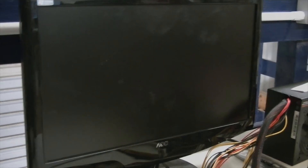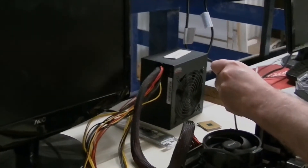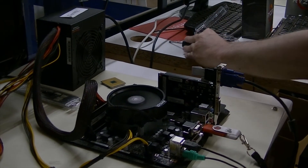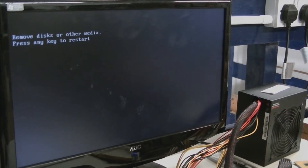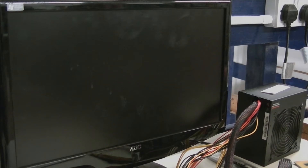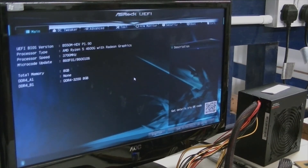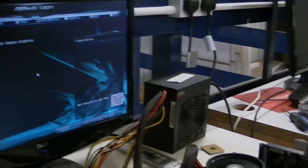We're now in position to see the screen. You'll have to look on your board layout for the power switch, but all you do — if you haven't got it plugged in — is just short the two power switches. We want to go into the BIOS, so I'm going to do a reset and press F2. As you can see, I've got the USB plugged in to the USB port.